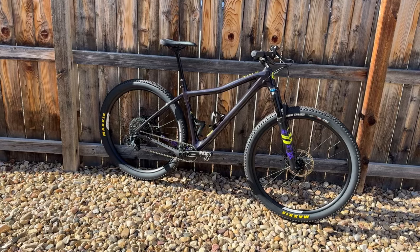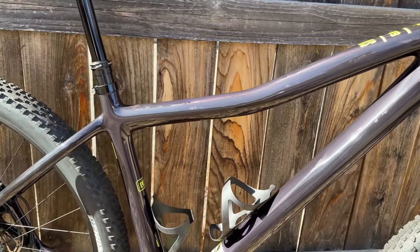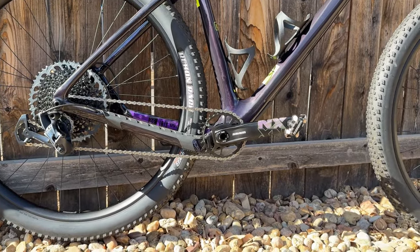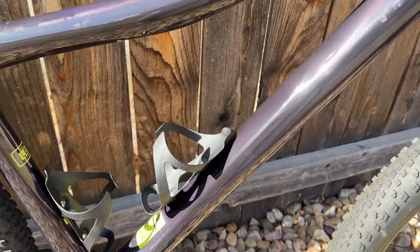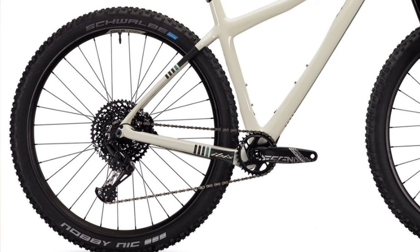So next let's look at the frame design elements as the basis for this bike. It is of course a full carbon frame and does come with a threaded bottom bracket, which I always like to see. One of the primary frame design elements I noticed immediately is that the seat tube meets the down tube ahead of the bottom bracket, which is not very common but actually yields much better tire clearance in the rear without having to lengthen the chainstays or impede the usable travel on the seat tube for a longer dropper seatpost. And comparing this bike to the prior gen you can see there's a lot more tire clearance in the rear, even without the need for the slight cutout in the seat tube that the prior model had.